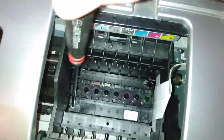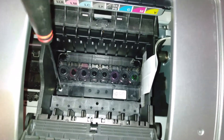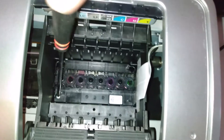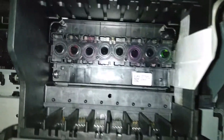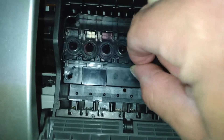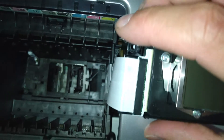I'm also going to show you the print head because I actually damaged it trying to clean it. Since it's completely ruined, I'm going to show you how I ruined it and how to avoid ruining it, because the print heads are ridiculously expensive. I've taken those three screws out, so now you can just lift this out — just grab part of it and gently lift it, turning it slightly as you do, because you have the ribbon cables there.